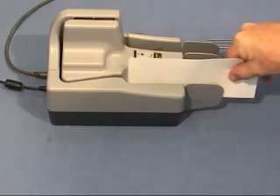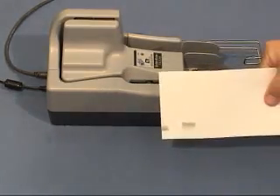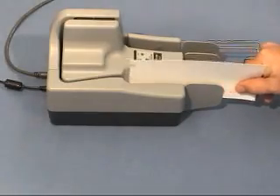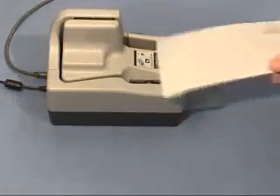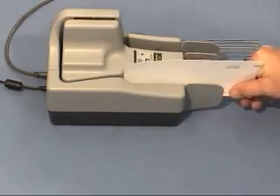Next, hold onto the card and select Scan from the ScanLite application, allowing the entry rollers to scrub the card. Wait until the motor stops, then remove the card, observing the dirt and flipping the card to a clean corner. Repeat this process two or three times depending on how dirty the rollers are.